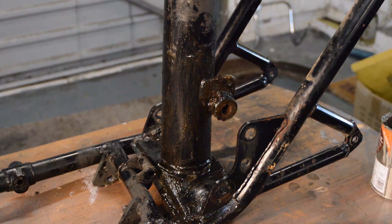While the frame's flipped over, I thought I'd show you the second application of paint stripper. As you can see, it very neatly gets rid of the remnants from the first application. There's very little abrasive work needed now to get rid of the remnants. Although it's slightly long-winded, I would imagine this whole frame will have taken me a couple of hours by the end — it's boring but relatively painless.